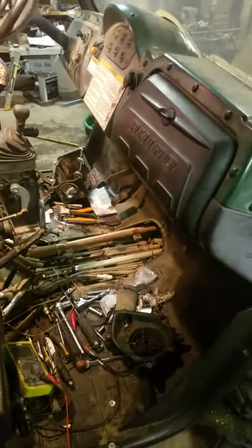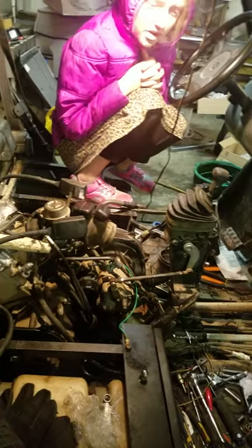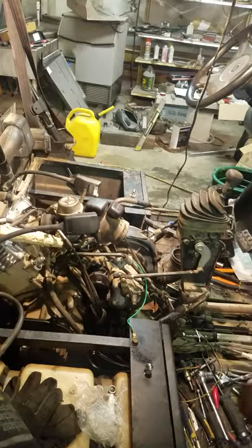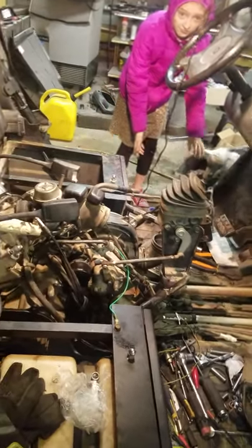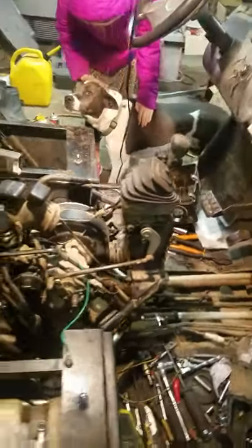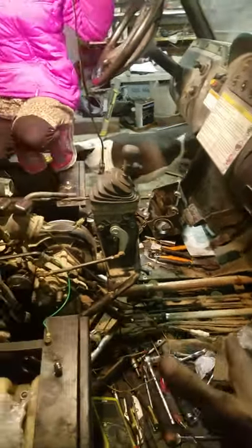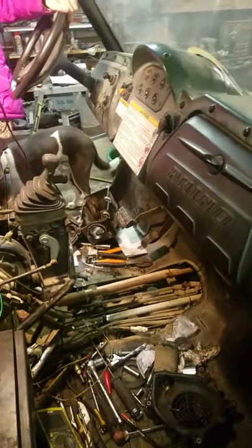This is just nuts — I've spent a lot of time on this thing to get to this point. I know there'll be people out there saying 'why didn't you check that first,' but there's a million things on this machine that will cause the exact same symptoms. Carburetors cause that symptom, bad valves cause that symptom, exhaust leaks cause that symptom, pulsar coils cause that symptom, bad coils cause that symptom — it's just process of elimination.